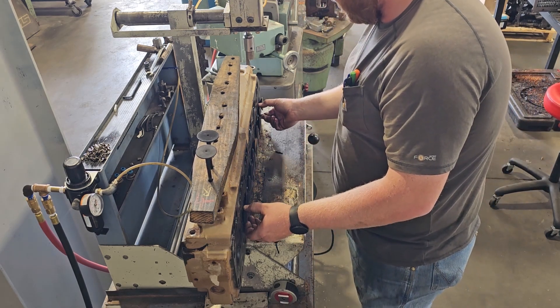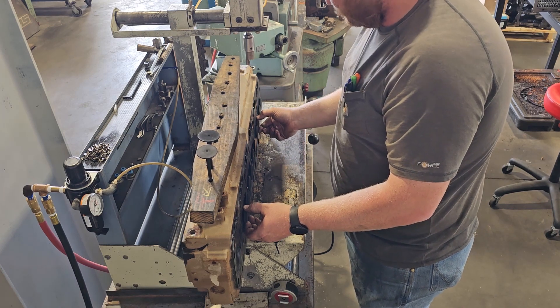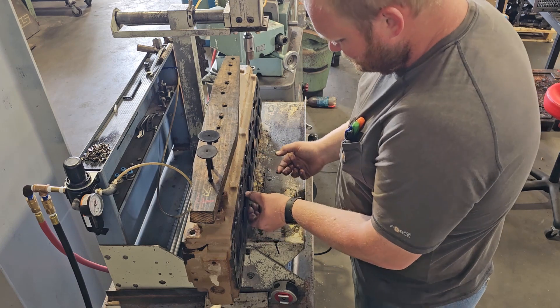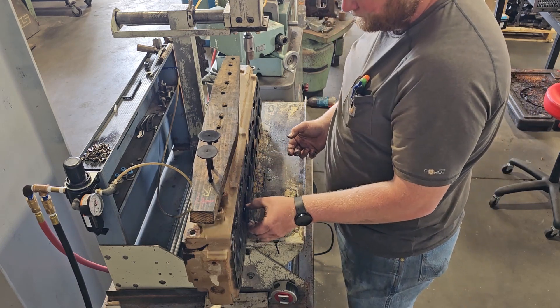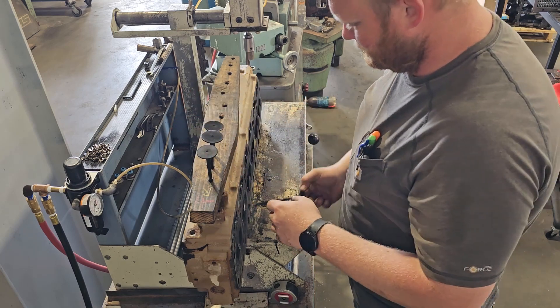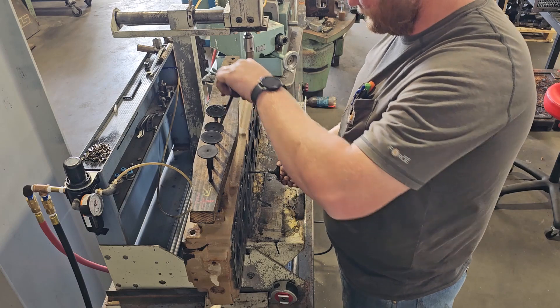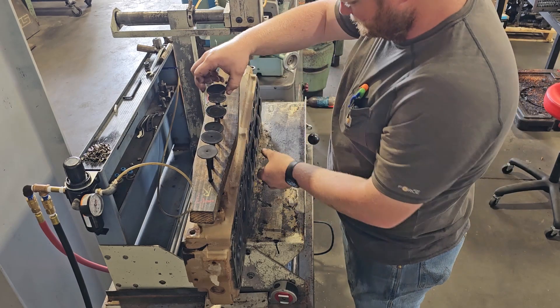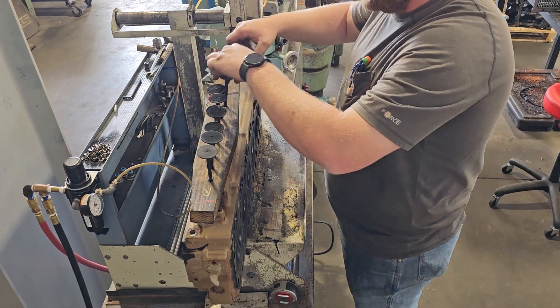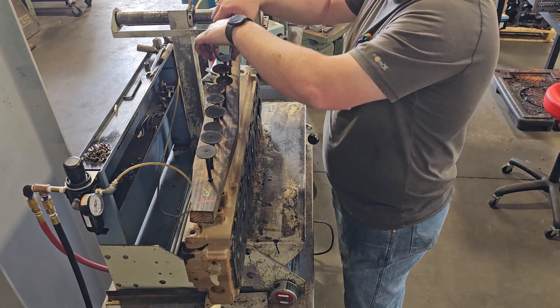As I looked into it, it had K-liners, and I'll get more into that in a future video when I drill out the cores on this head and put in new valve guides. I hate K-liners — they're junk. A lot of shops put those in and they're just terrible. I'll get more into that on the next video as I rebuild it, put new guides, and cut the seats.